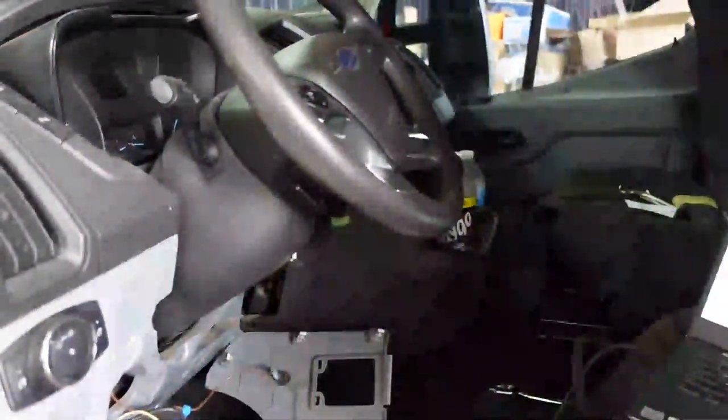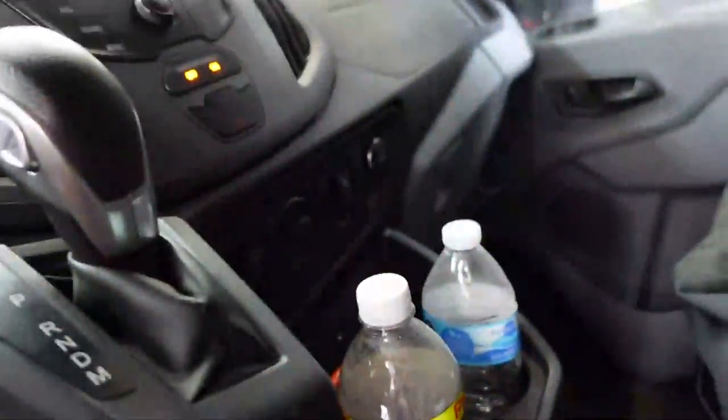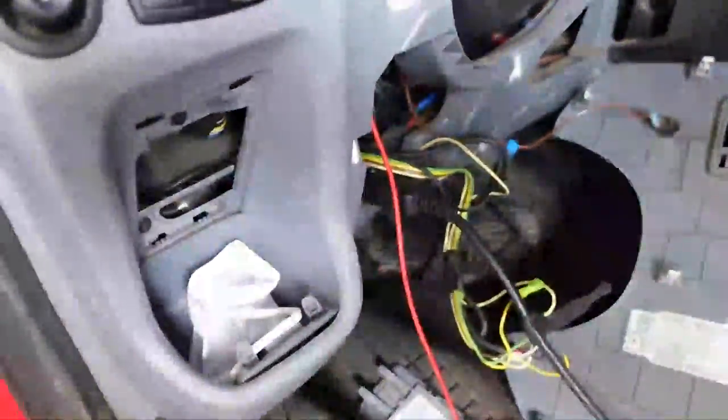All right, I had the blessing of talking to a very smart person to help me out a little bit, and we checked a lot of stuff. One of the things that's interesting is that the blower motor should come on with accessory and key on, and it doesn't. But if we go ahead and crank, you may not be able to hear, but the blower motor does come on. We checked a lot of our other inputs to this BCM, checking around a lot of stuff.